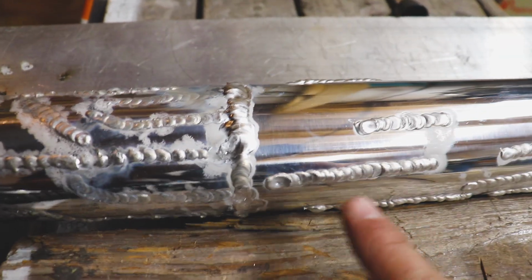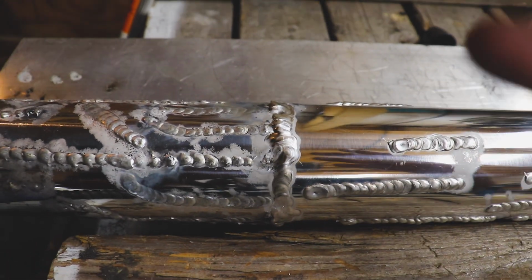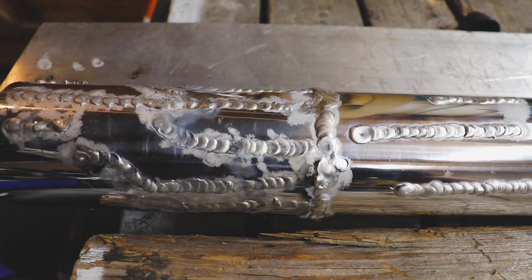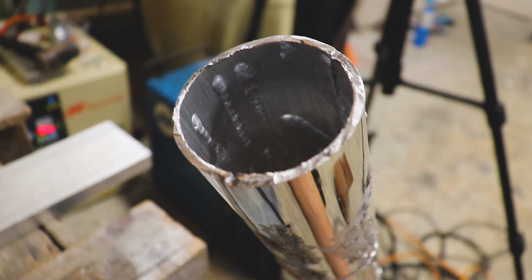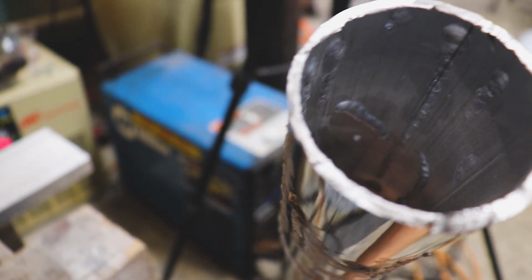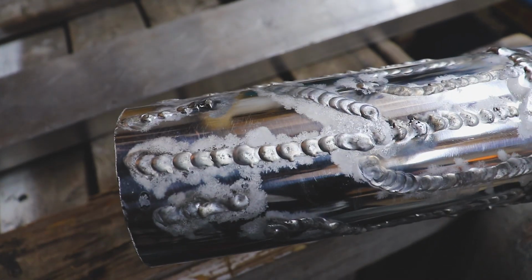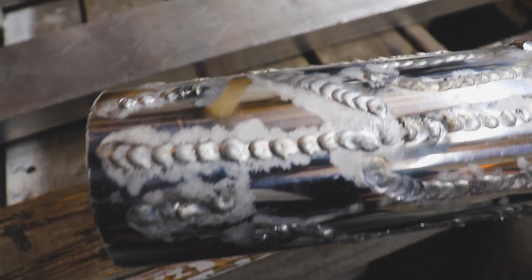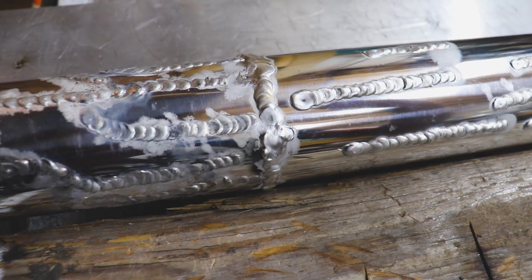It is a little bit different than just welding on top of this tubing, so at least we're with the intake where it's nothing super vital. It's nothing that's gonna be under boost. It'll be vacuum. And I've been paying attention to the penetration that I've been getting. If I'm too hot, there's some sections like right here, this weld. You know, the settings were pretty good, but that's when we had the other tip in there and probably not enough gas. I feel comfortable enough that I know this is gonna weld together. It might not be the prettiest thing, but it's all part of the learning experience.